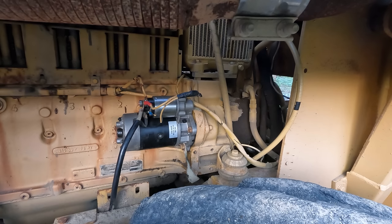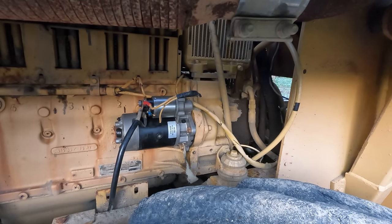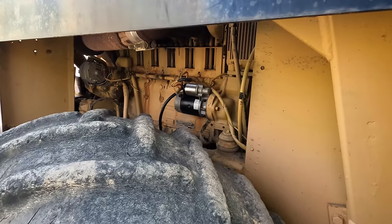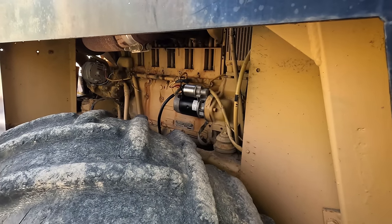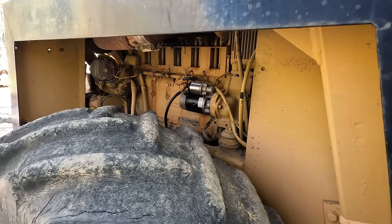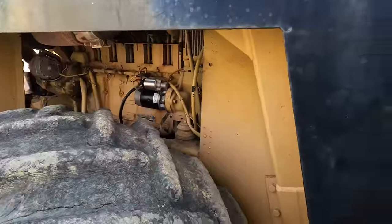Moment of truth — is the starter going to engage? Contact! It was perfect — it engaged so nicely. Heck yeah! Let's give this starter a true test. We'll fire this thing up and get the engine heated up so we can drain the oil. I also decided to start tearing into the electrical here and figure out the gremlins in the push button control, because they had the vibration control — which should have been in the handle — rigged up into a toggle switch. I picked up a manual so hopefully we can sort this mess out too.